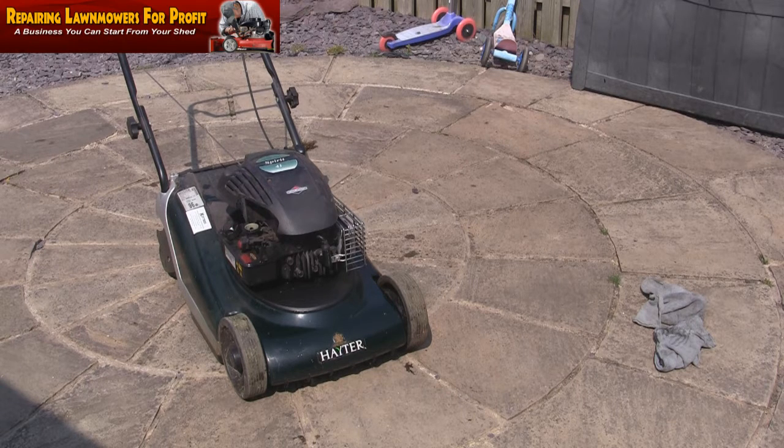You don't necessarily have to tip it up. You could get the extractor. I couldn't get the end of my extractor, I don't know what I've done with it, but I couldn't get it down the hole far enough, which is why I tipped it up. Of course, if you can get it running a little bit and warm this oil up, soften this oil up a bit, when you extract it or tip it out, it comes out a lot easier as well. Just a little tip there.